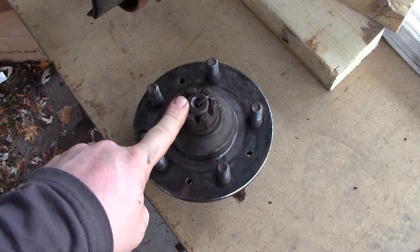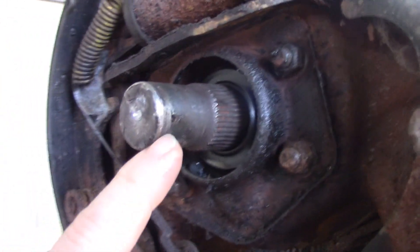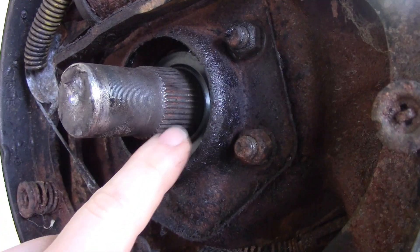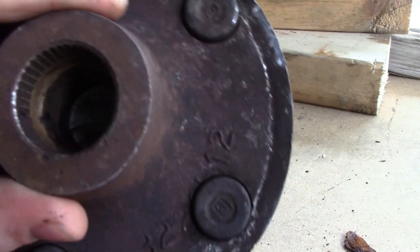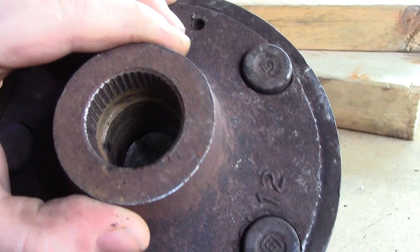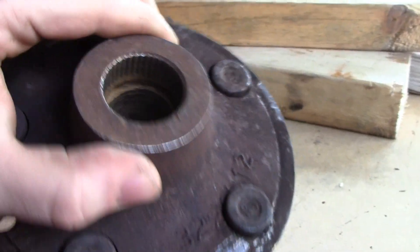So what exactly are we looking at here? This is your axle hub — the drum goes on here, there's your axle shaft nut, and the axle's in there. From what I can tell, it's almost a clean shear. These splines have completely worn down on the inside, and these splines have also rounded out. There's a keyway in there which, if I can tell, is completely trashed.